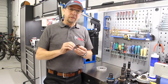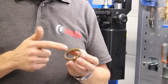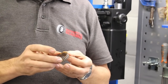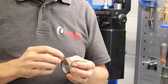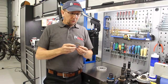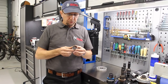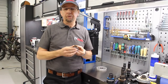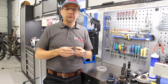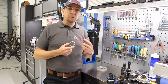What's needed is an uprated bearing, and finally we have one. As you can see, it's got much bigger sprags and it's also got much wider bars in between each sprag. This will allow it to transmit the force through the bearing without snapping the bars in between, which will then stop the sprags actually flipping over. So this is going as part of our upgrade package — we're going to be doing an upgrade for these motors with extra sealing and uprated bearings, especially for the earlier motors. Brose have changed this in 2021, so we can look after the older motors leading up to that time.